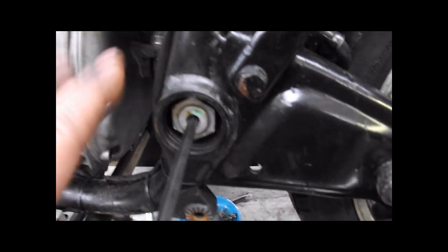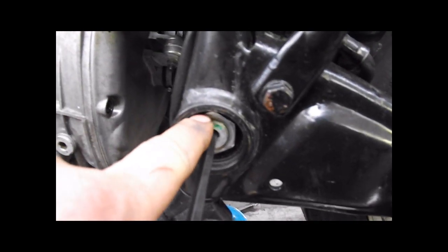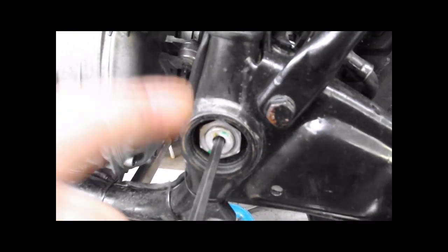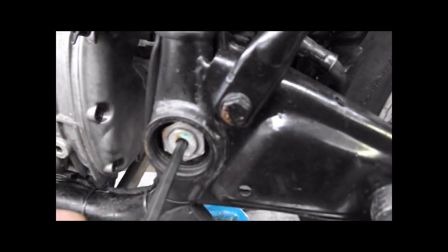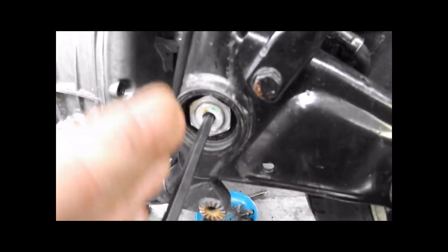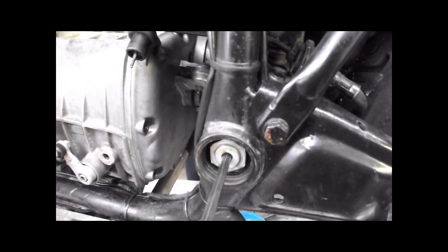While Sean's working on that, I'll explain the paint mark issue. When you think you're there, put a paint mark on the nut and pin. Torque the nut. If they didn't move and they turn together, then you know you have a problem, and you need to find a way to secure the pin from turning so that just the nut turns.